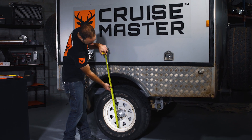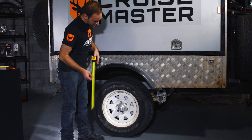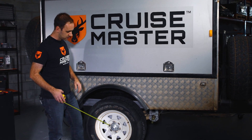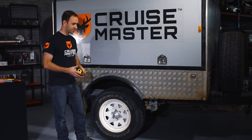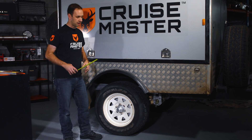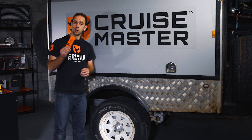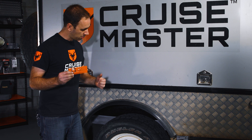One way is you can measure from the bottom of your rim to your wheel arch — that's nice and easy. Just make sure you don't measure to the ground because tire pressure will affect that. Another way is you can make up a piece of wood to go between the guard and the tire as a reference point. Alternatively, we have CruiseMaster ride height indicators — a visual indicator that we stick on the inside of the wheel box — which makes it nice and easy to confirm your ride height is correct.